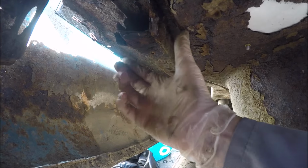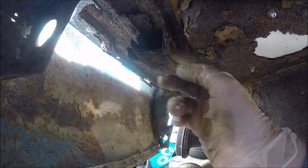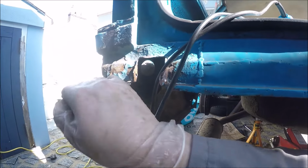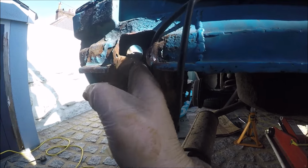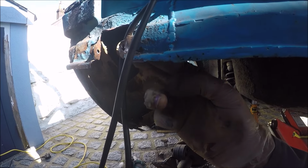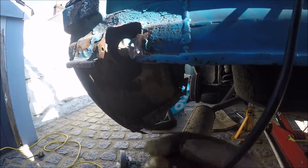Oh, hang on, no, that was fresh. No, this side. But beforehand this was damaged. It was as if it had been pushed in. And if you look here, this has been pushed in as well, so with a hammer bring that out and have it level with the new valance when it goes in.